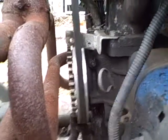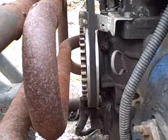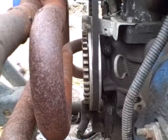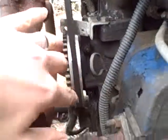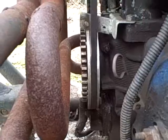Let's talk EDIS for a minute. That's a factory Ford toothed wheel that has been bolted to a Berg power pulley that I got off eBay. The first time I did this, it had a cheap power pulley on it and I didn't get it bolted down real good — it came loose a little bit, hit the crank angle sensor, the wheel exploded, and I ended up having to tow it home. So make sure you get those bolted down very tightly.